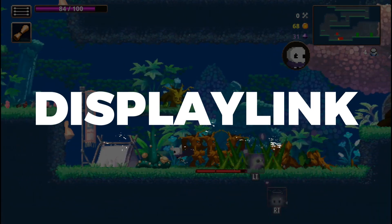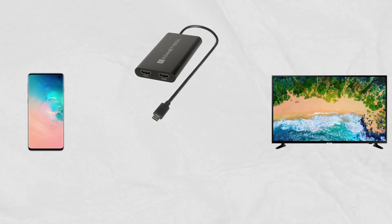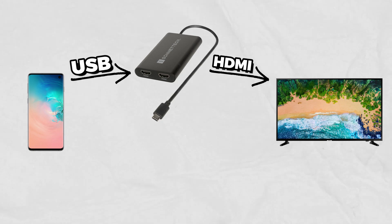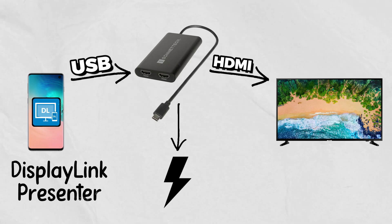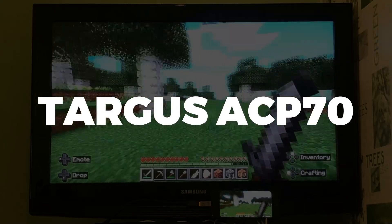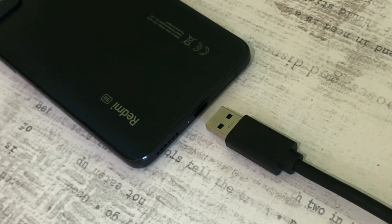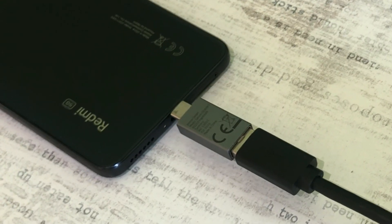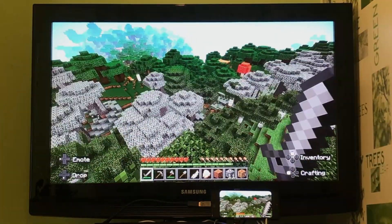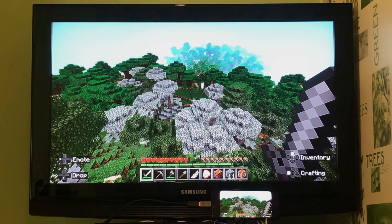So we're left with DisplayLink and Screen Copy. By DisplayLink, I mean an external DisplayLink adapter that acts like a middleman between your phone and TV. You connect your phone and TV to the adapter via USB and HDMI respectively, and also plug the adapter into a power supply. Then you install the DisplayLink Presenter app and set it up. The adapter I have is the Targus ACP70 — included in the box is the adapter, power cord, and a USB Type-B to Type-A cable. Since your phone has a USB Type-C port, you'll also need to buy a USB Type-C to Type-A adapter. The whole setup cost me about $13 and it works fine. There is a slight delay, but it's not really noticeable.